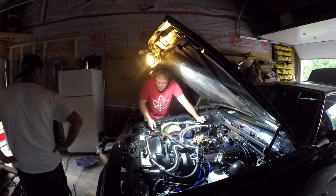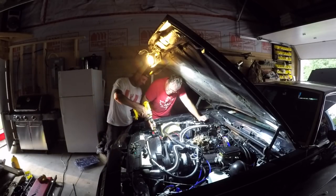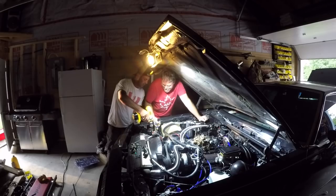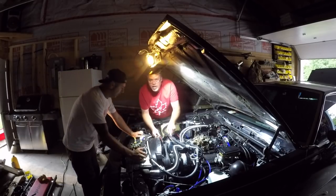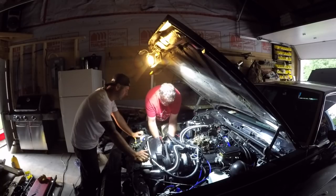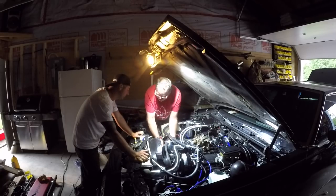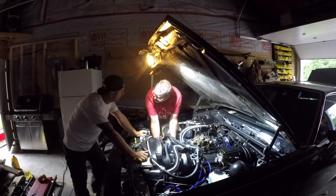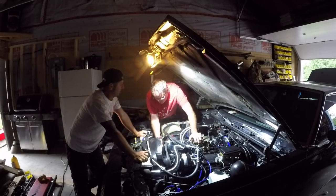I'm putting my cameras on record alone. What else did you take the other day? Where the hell's your drill? You just had it. I set it right behind me — you got to rely on the camera and figure it out. You holding this one? Yes I got it. You move it so I don't hurt you. It's pretty hard for me to move it — I'm holding it straight up and down. So we're doing the ground relocation. It used to be on the factory bracket here but we're going down to the bottom bolt of the old alternator boss because you can't see it, it looks better, and less wires is better. It's going on the back side. No man, you can't put it on the back side — that will throw the freaking belt off. You're putting a quarter inch washer where it shouldn't be. If you put it in front of the bolt then it's not affecting alignment at all.